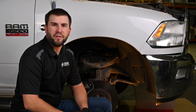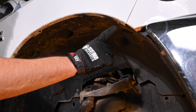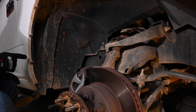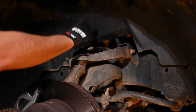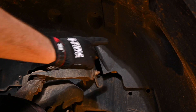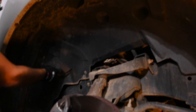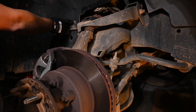Now that the wheel has been removed, the next step is to remove the inner fender liner. We will remove the fasteners starting with the 8mm heads here, with two more in recesses above. There are three push clips located here, and one push tab for a wiring harness behind the liner.